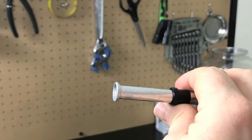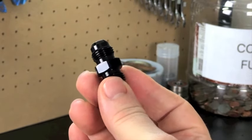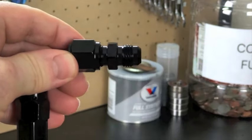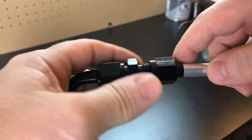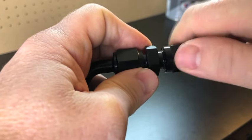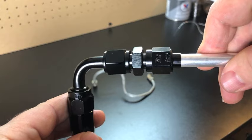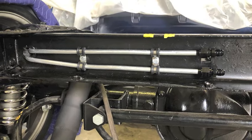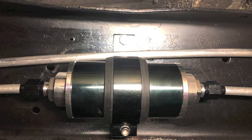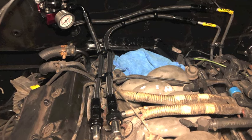Here is what a 37-degree flare looks like. To connect the hard line to the nylon hose, I needed a double-sided 37-degree fitting — it has a 37-degree flare on both sides, which allows me to connect the two fittings together. And there you go, the final look. With that I was able to hook up hard lines to soft lines to my fuel tank, which I then connected to a fuel filter, then finished off with hard lines to soft lines connected to fittings that connect to the fuel rails on the engine.